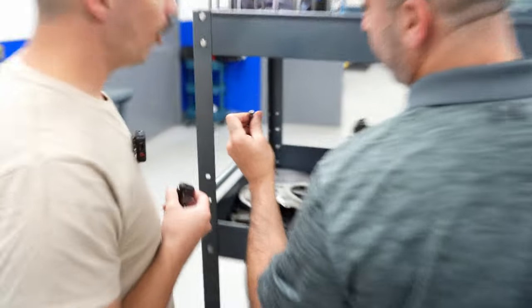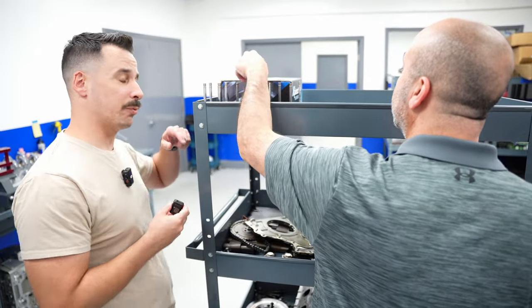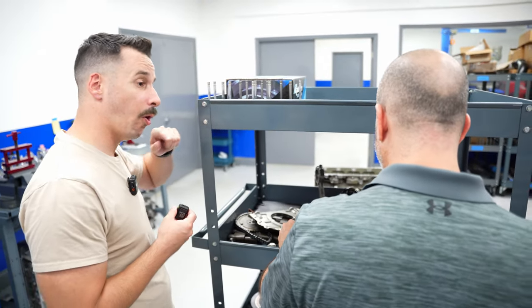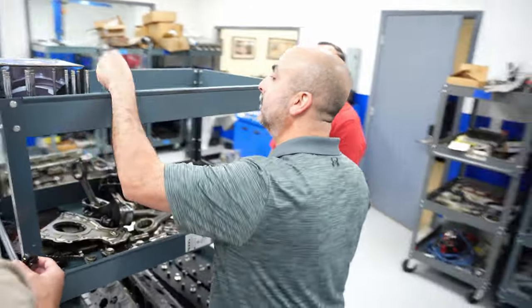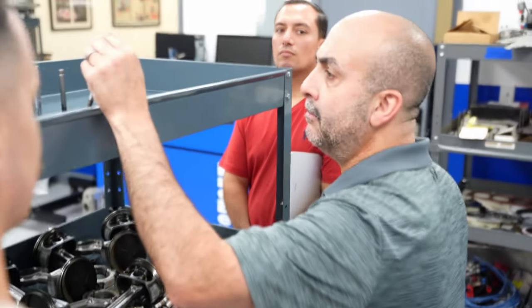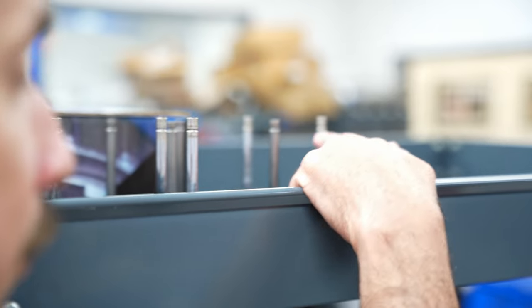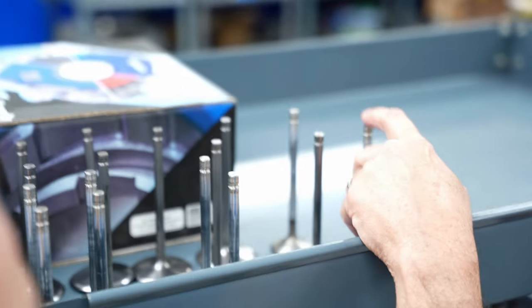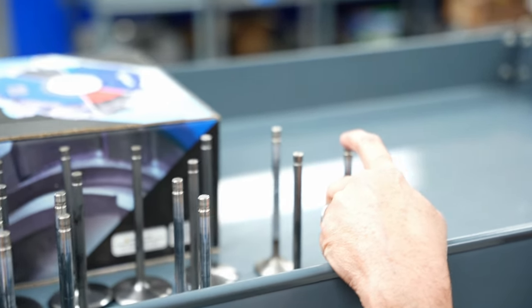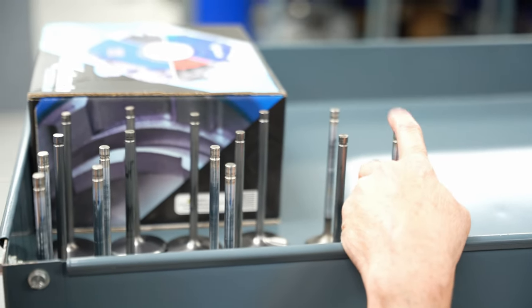Some of these are mushed because they didn't put the lash caps on and we ran the car without lash caps. Then they put lash caps on all valves and it's not supposed to — it's only titanium. You can put them on stainless to get your geometry, but it's not something that's needed. Look at the difference in the tip lengths. This one has a longer tip length, and if they put a valve lash cap on this, now when the preload is set on this one, it's all the way bottomed out. That's why we're finding some of these broken.